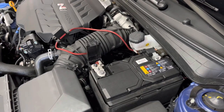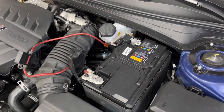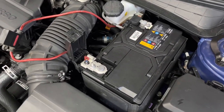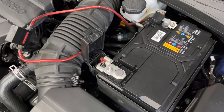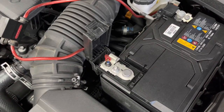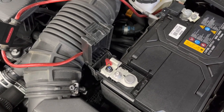In my previous video, I only had a 10-inch subwoofer installed. The subwoofer required a minimum of 8-gauge wire to be used for power and ground. For this install, I'm upgrading the power wire to 0-gauge. I could get away with 4-gauge, but I want to make my setup future-proof. If you already have your power wire installed, you can skip to 3 minutes and 35 seconds.